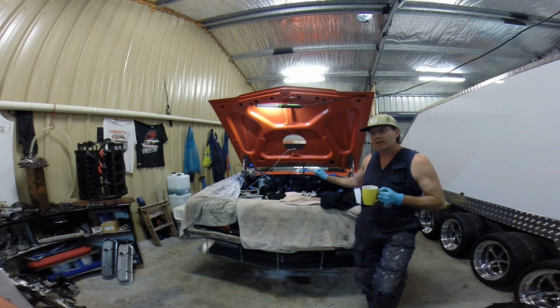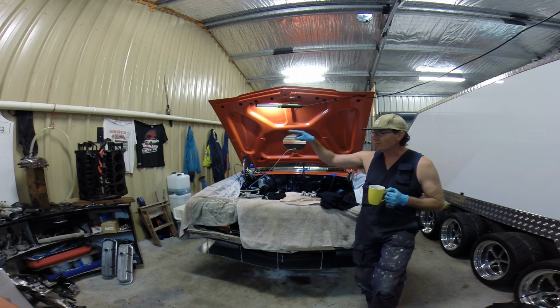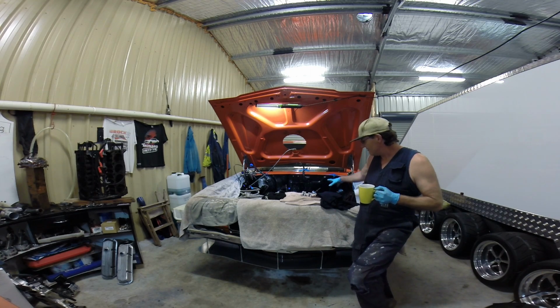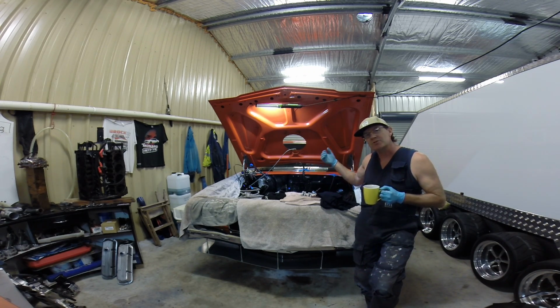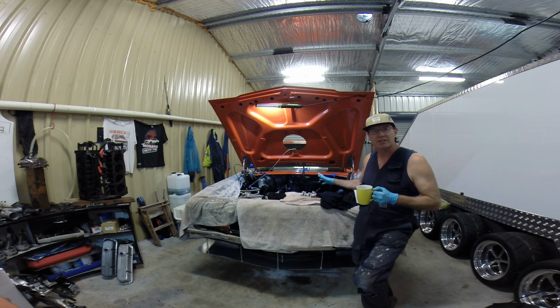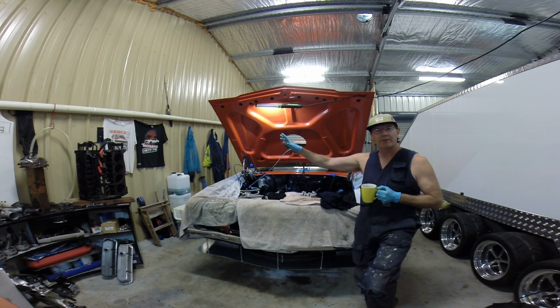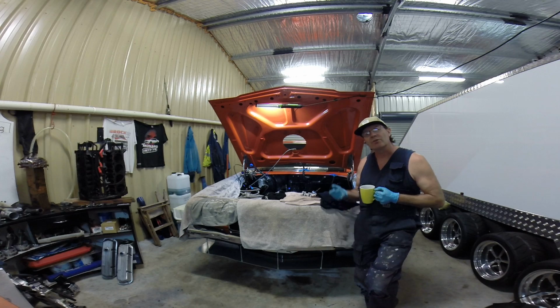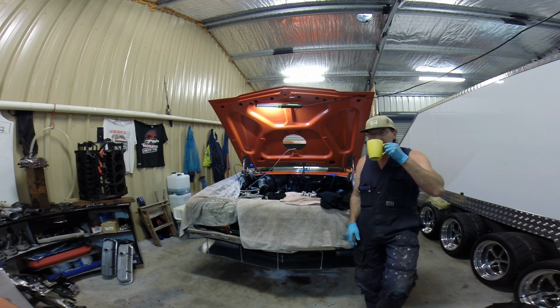That'll crush, because the heads grow a little bit, the aluminium head, and it's going to crush the gasket, but then when it cools down, you've lost that tension off your bolts, off your studs, just a whisker. I remember when I did it the first time round, and I've done it twice now, there's 10 main head bolts, and I think about 7 or 8 of them needed that little bit extra to get up to the value. The others were fine, so it does need that extra torque down. Cast heads, you get away with it, there's no trouble with them. But that's the only drawback I'm finding with these aluminium heads. It's a bit of a pain, but it is what it is, and for all the other benefits, it's a small price to pay, guys.